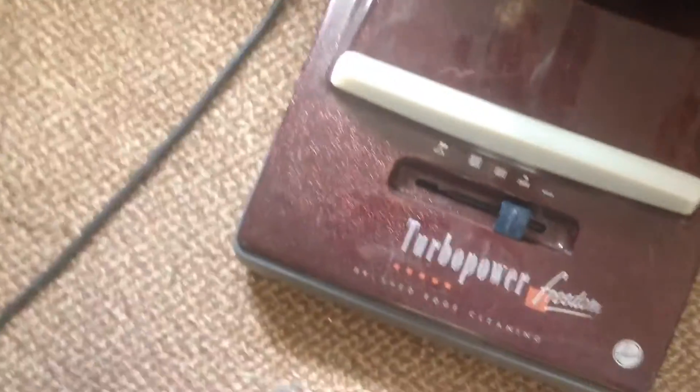I'll get a screwdriver in a minute. Right, we're back again - I'll just check the fuse. It's got 13 amp and I'll put a 3 amp fuse in it, so that's fine. We put the handle on now. It's a bit dusty. I'll just fire it up to see if it doesn't explode. It's quite quiet - it will clean up lovely. It's got a flake effect all over it so that looks nice.